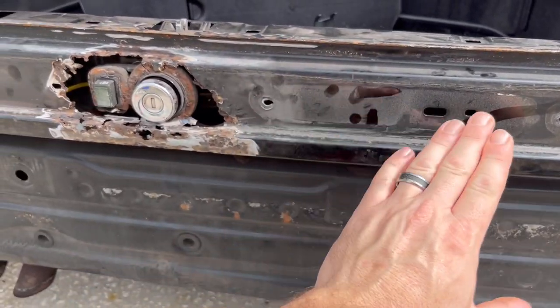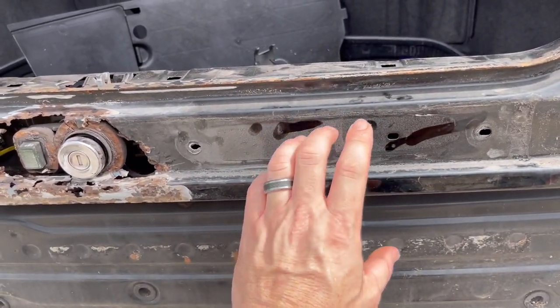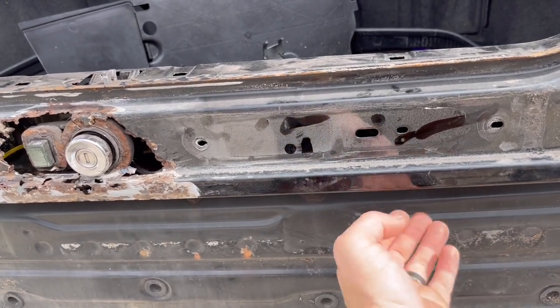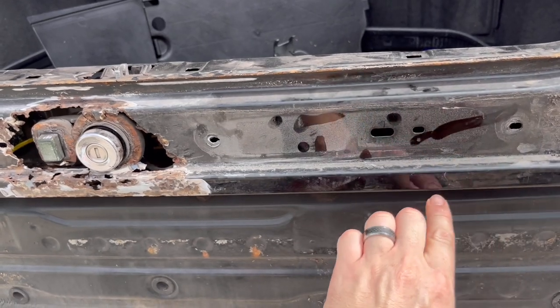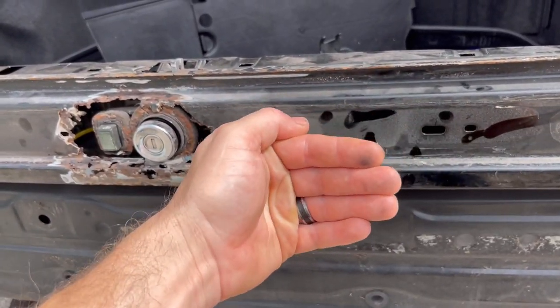And the reason why is this mirrors this area here. So what we'll do is put some Vaseline down so the fiberglass does not stick. We'll fiberglass a piece all across here, up underneath here, around here to make a mold. Now that mold will be then placed on top of this, but we're gonna reinforce it really well in the back of it.